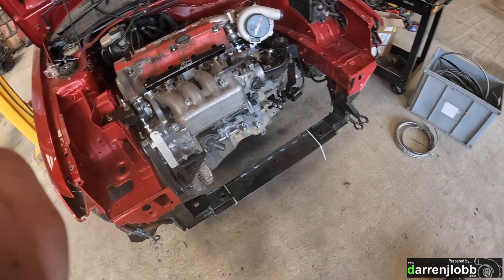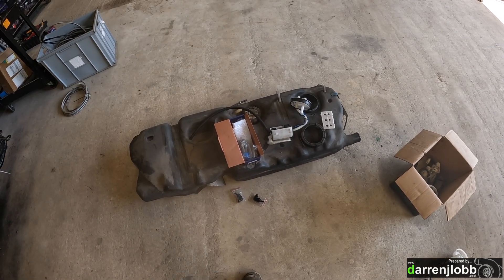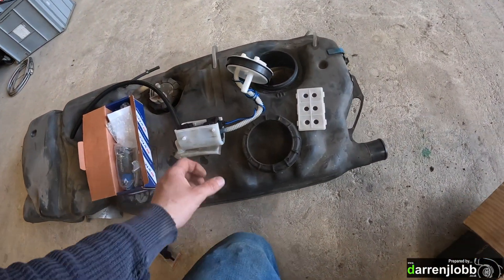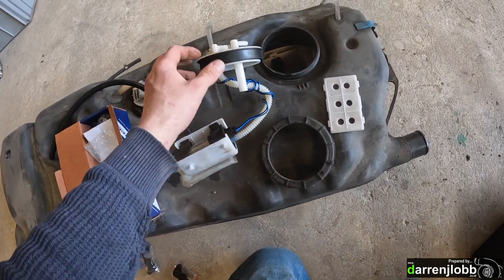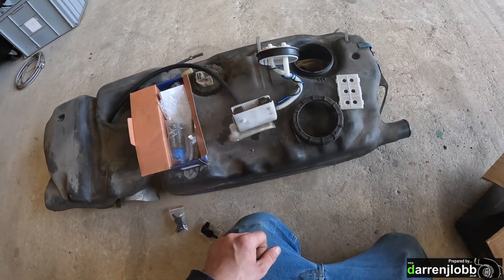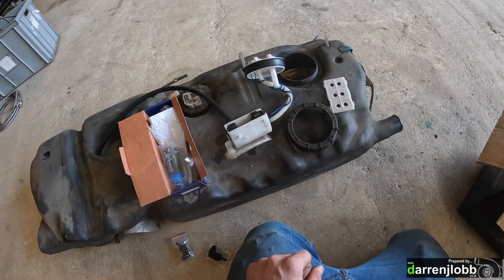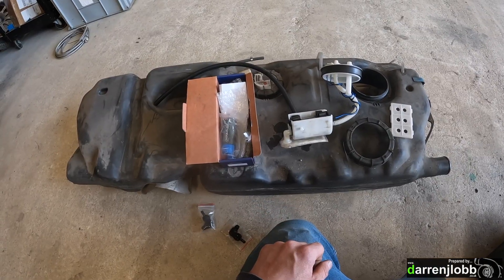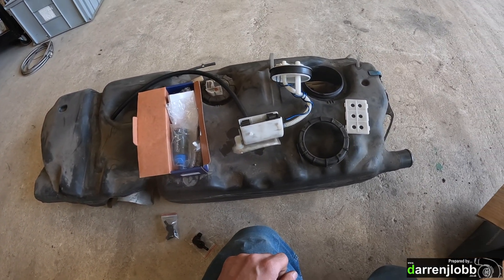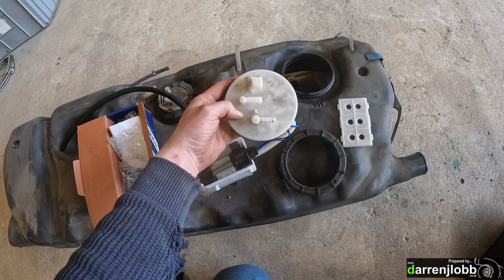The next thing I was just looking into is the fuel tank situation. Me and Sam had a fiddle with this when Sam was down last and we've got really lucky - this is the factory tank out of the Cabbie and its factory fuel sender. It's a bit different in the Cabbie model compared to the hatchback, but after taking it all apart, and also tearing apart the factory EP3 Civic one, believe it or not they have exactly the same style fuel pump in them. That means we've been able to order an off-the-shelf upgraded fuel pump designed for an EP3 Civic, knowing it will bolt straight into this tank - which is brilliant.